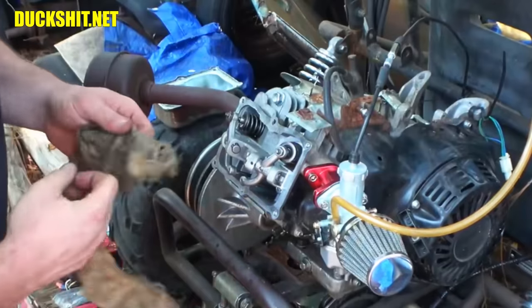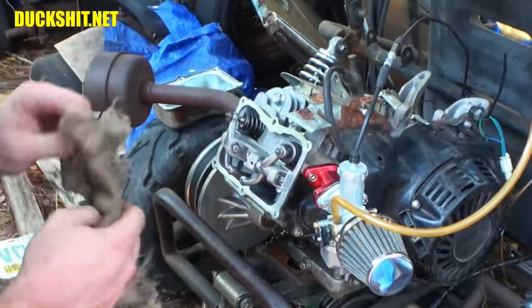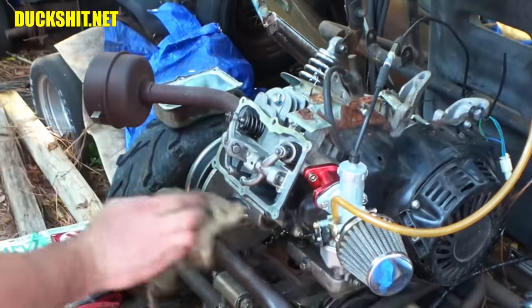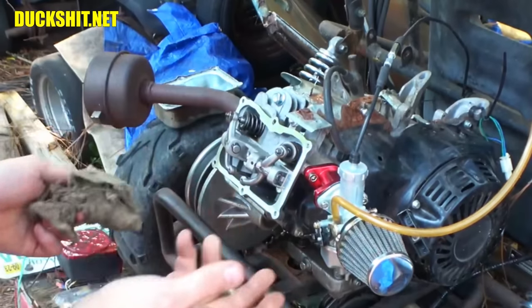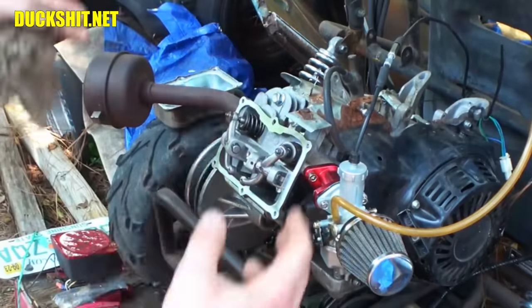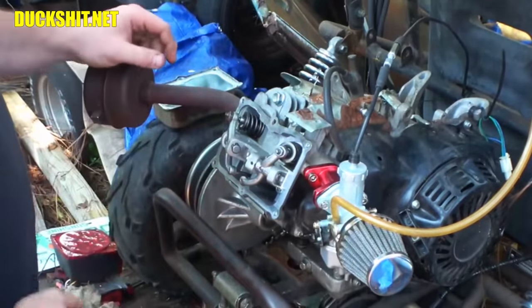Yeah, it might have been that problem all along. Anyway, we got stronger valve springs on her. Yeah, I know, 50-pound springs versus 25-pound springs may be a little parasitic until we do upgrade the engine, but it will give me more revs, if you will, because the valves aren't going to float.